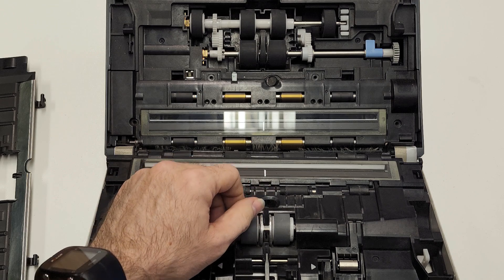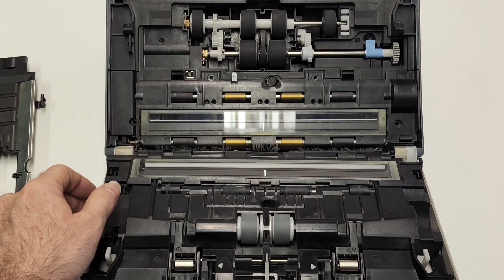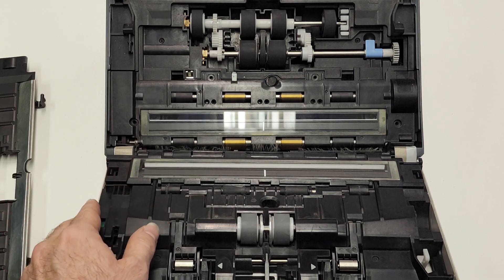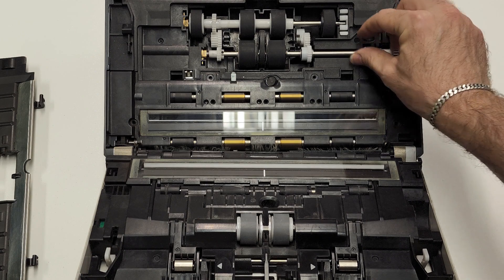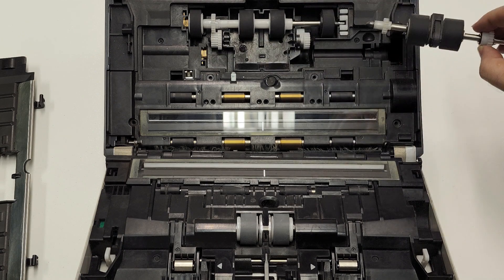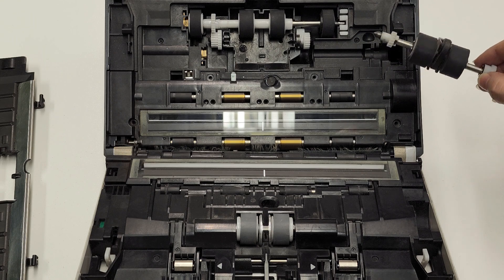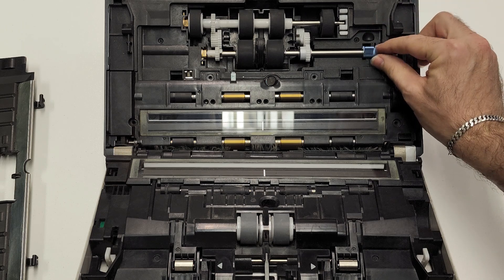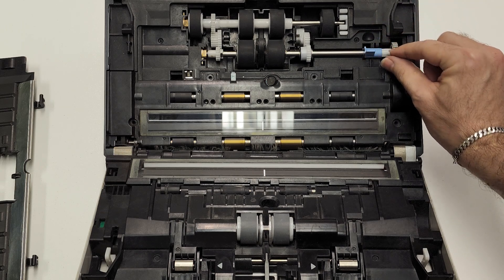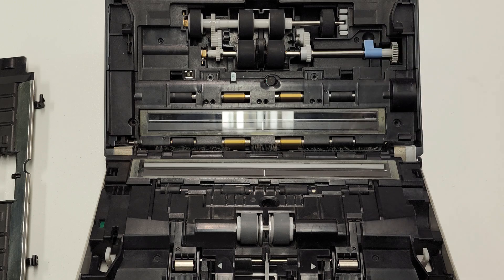Please note that A-Vision does not consider the pickup roller a consumable item. This roller can be replaced if deemed necessary following a visual inspection. To replace the ADF roller, open the roller cover and rotate the blue tab on the right-hand side up 90 degrees. Lift the roller assembly slightly, and then pull the assembly out towards the right. To fit the new roller, ensure that the pin engages in the left-hand brass bushing, then locate the ADF roller assembly's gear on the gears on the right-hand side of the unit, with the blue tab perpendicular to the chassis. If located correctly, the tab should lock in place when pushed 90 degrees with little resistance.